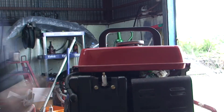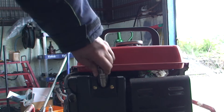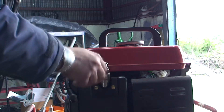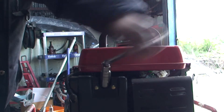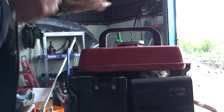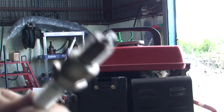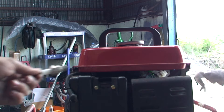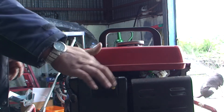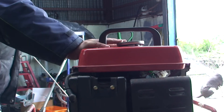Take out the spark plug - looks like a 22mm. Take it out and just give that a bit of a clean. It's the end of the day, only take a second, it's no harm. To be fair, the spark plug is very clean, so I don't really need to clean it. But I'd say this is just absolutely flooded. So I'm just going to give it a few pulls with everything off, the petrol off as well, just to try and maybe release some of that.